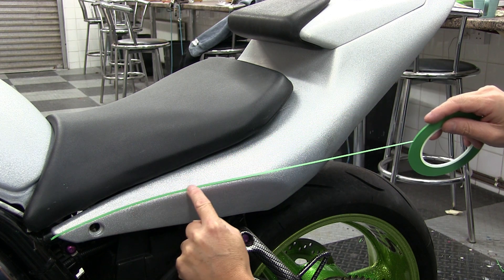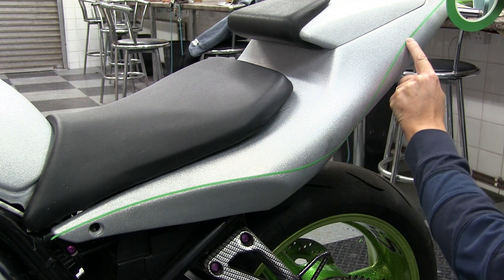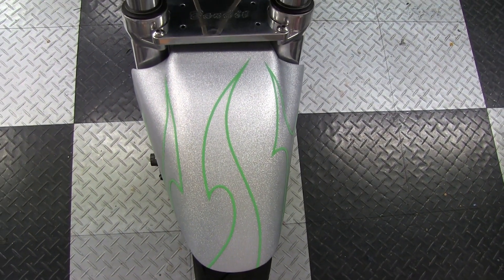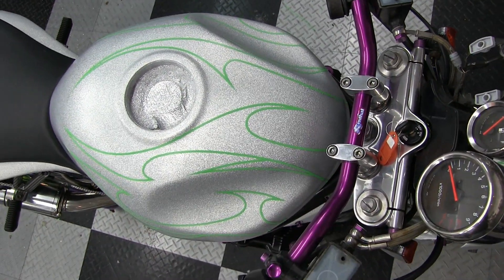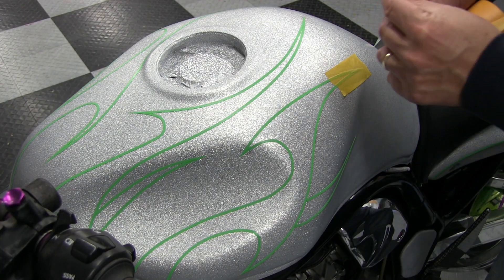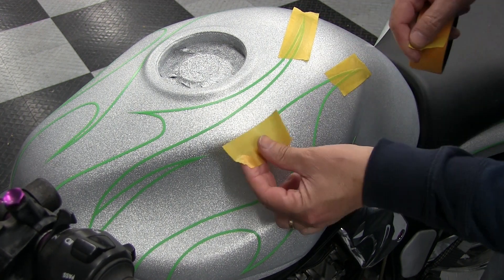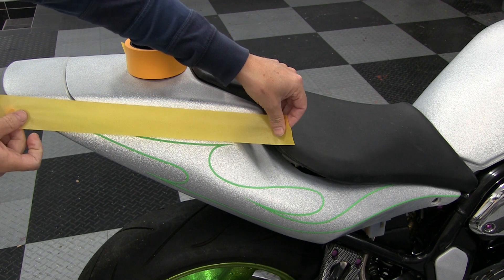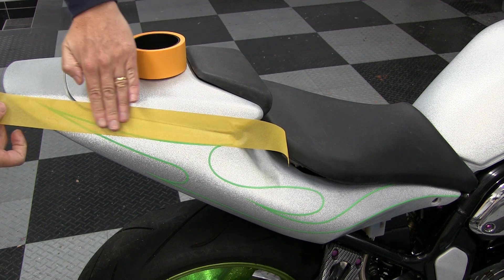I'm just using my Flake King 3mm fine line tape — 3mm fine line is kind of my go-to for general graphics; I may go 6mm on large scale, but in general for motorcycles I use 3mm. I'm just going to line the bike out here. You might get it right first time, you might get it right second time — if needs be, even draw it out a little bit with a chalk pencil. One good tip: if you're leaving it overnight or over the weekend, always stick a little bit of masking tape on the tips just to stop it dehydrating or lifting during the night.